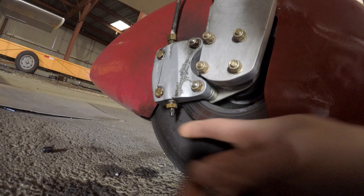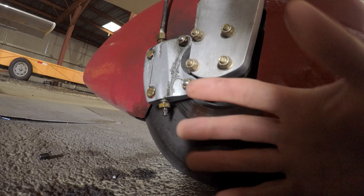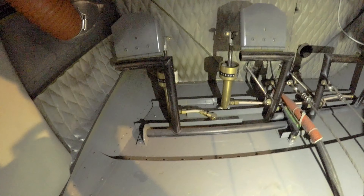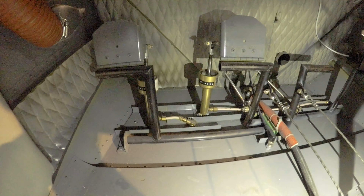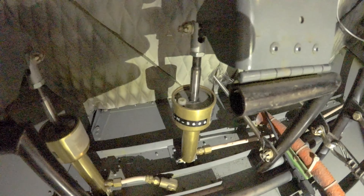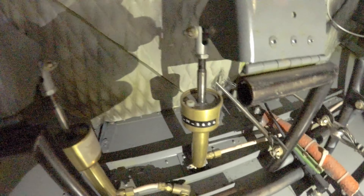You're just kind of filling up the hose and the reservoir up top. I'm going to go up top and loosen up the little bleeder air vent on the master cylinder. Here we are in the cockpit. I only have single brakes on this, and I'm assuming that makes this a lot easier. Here are the master cylinder and reservoir combo units — you can see there's a little Delrin or plastic plug up top, and that's just the vent hole. We'll need to loosen that with a hex bit.